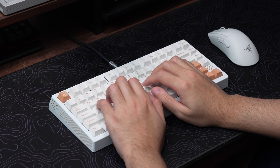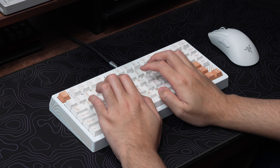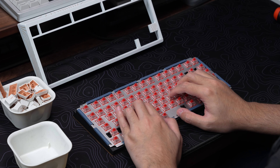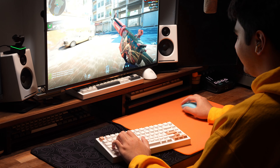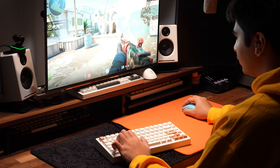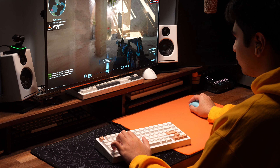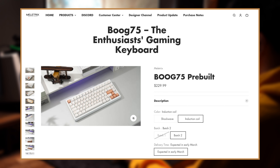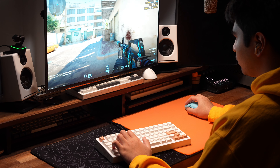Now talking about feel, the board itself does feel pretty stiff, but definitely not tray mount levels of stiff. But don't get me wrong, that's entirely by design, because if the board ever flexed or bounced like every other mechanical keyboard on the market, it could really mess with how the PCB receives signals from the magnets, since everything is calculated on a per-millimeter basis. Now talking about performance, it's just phenomenal. The ability to customize the board functions with Rapid Trigger, the ability to set your desired actuation point on a per-key basis, and just the sheer level of functional customizability on offer makes this keyboard a great fit for just about everyone. Especially if you're someone that wants to really dial in how you want to perform with your board. Mellotrix have really released a banger here. And while the $229 retail price can seem steep, I can safely say it's worth the price tag. Especially when you put it up against so-called gaming keyboards from other competing brands. Honestly, a lot of other gaming keyboards just pale in comparison. This is probably one of, if not the best gaming keyboard on the market in 2024.